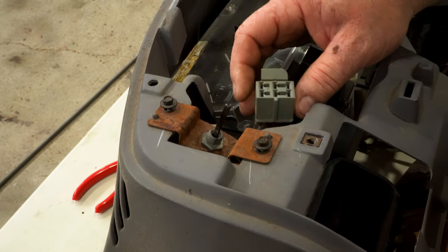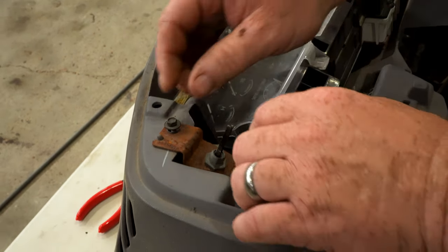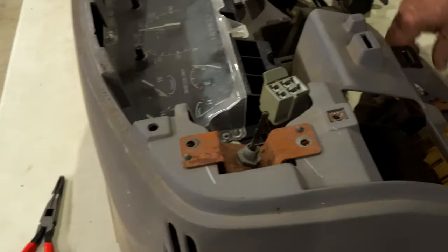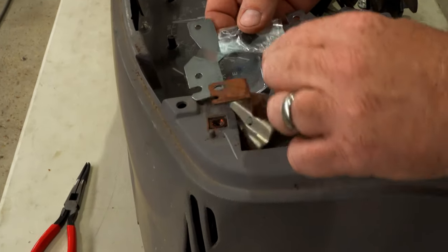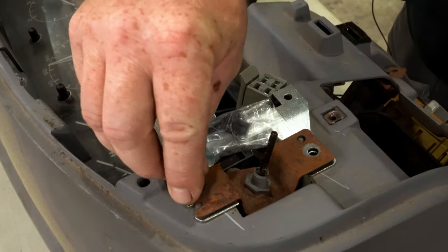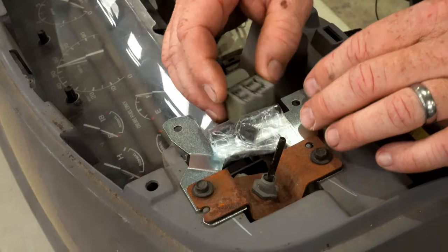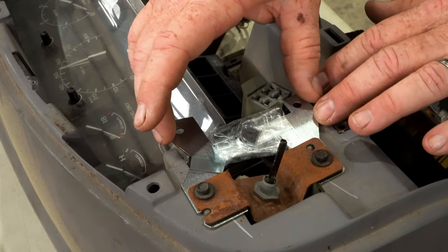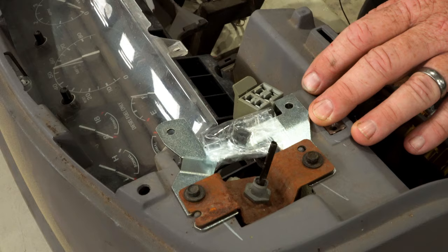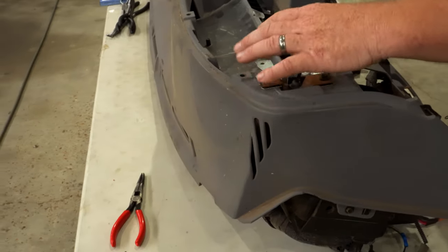So we're going to go over this fix for the fuel tank selector switch or Bronco rear window switch. Simple. These are two 7-millimeter screws. Pop those out. The new bracket slides right in behind it. Put your screws back in. Plug your switch in. Your switch will now mount to this bracket instead of the dash bezel. So if your dash bezel's broken, missing those plastic stands for the switch, this is the fix for that. They're very, very nice, solid.